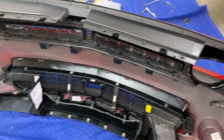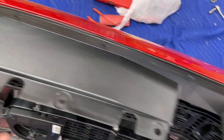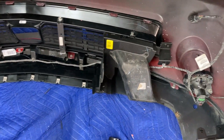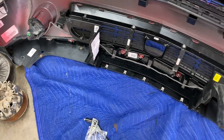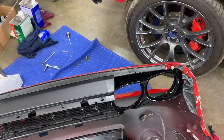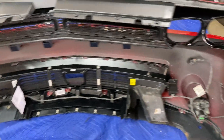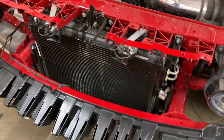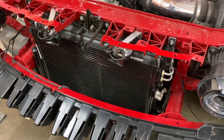It's been a couple days and I finally got all the plastic rivets I needed, which are a ton for this bumper. I've got this seal put on up here with all those plastic rivets, so that's all where it needs to be. I've got these pieces here riveted in. I'm waiting for one more ductwork to come in for the driver's side brake cooling. Then this thing will be ready to install. These bolts mount onto the front of that fender. I can go ahead and get that front piece installed and then the bumper goes over it.